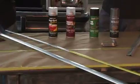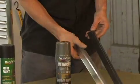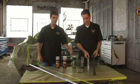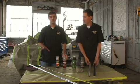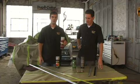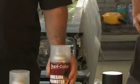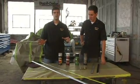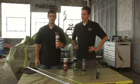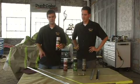We do have a piece that we tested right there, and it did come out pretty well. We're going to see how it works with the other stuff before we decide which one or the other we're going to go with. Now, typically, when you are using metal cast, since you're not going to be scuffing the piece under normal circumstances, you do want to use adhesion promoter because you need that to help the paint stick to the surface. Now, also, before you get started with any project, you want to make sure that you prep it and get it nice and clean, and for that we're going to get all these things nice and clean with the prep spray, get it ready to go, but I'm going to scuff these down first.